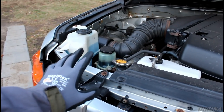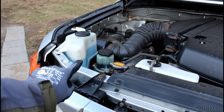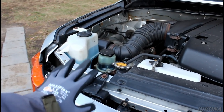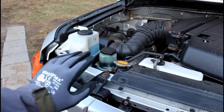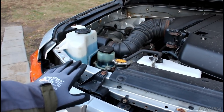A couple other minor things: I also change out all my windshield washer fluid for a winter mix. Where I live they sell a summer mix and a winter mix. The summer mix will freeze in the winter if it stays in the reservoir, so I make sure to flush the majority of the summer stuff out and put the winter stuff in before we start getting freezing weather.